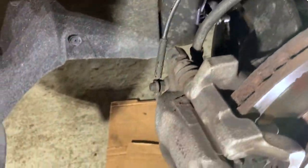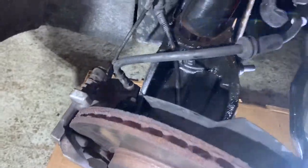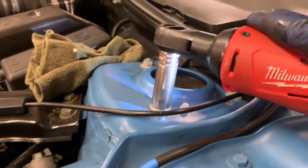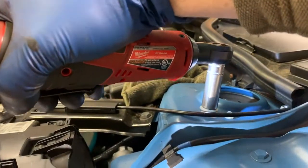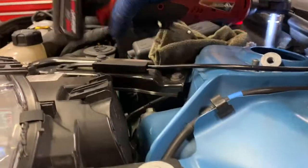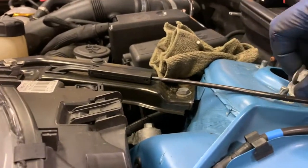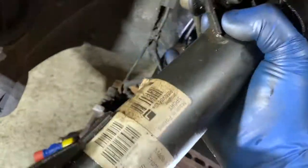Try not to hit these wires because if I do, that's bad news. I'll put the phone down and use my other hand to move these out of the way when I hit. Now the strut tube is disconnected from the steering knuckle — I can swing this whole unit around. Now that it's free, I'm going to loosen these top bolts up here and then pull the strut. At this point the strut is actually free to come out — let's walk it over to the bench.